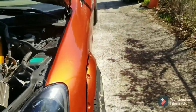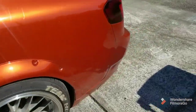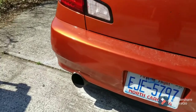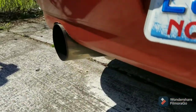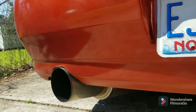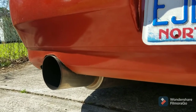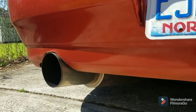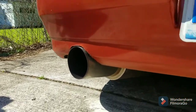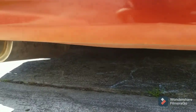ISR Y pipe and the ISR 350Z GT exhaust coming out the back here. The exhaust, I have a very heavy duty zip tie as a hanger. I actually use the flexi cuffs that police use. I cut one in half to use because they're extremely heavy duty, so I can tuck the exhaust up and cut the bumper around it so I have a little bit better clearance.